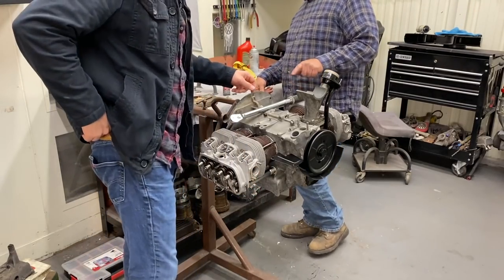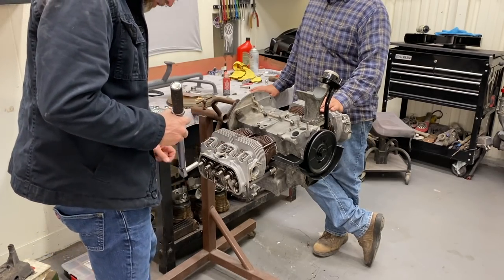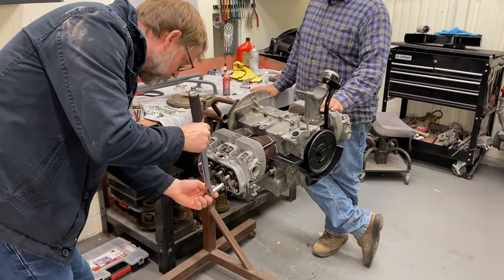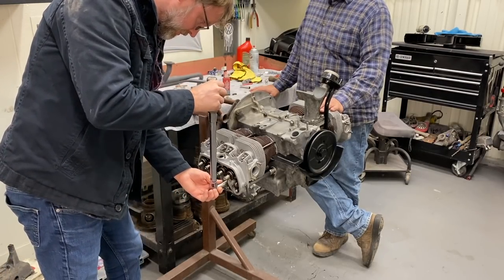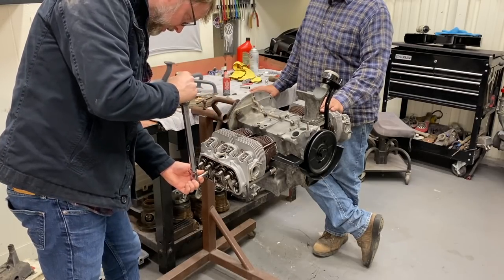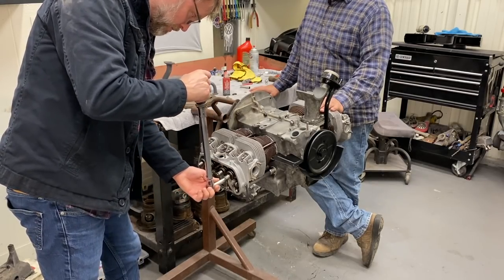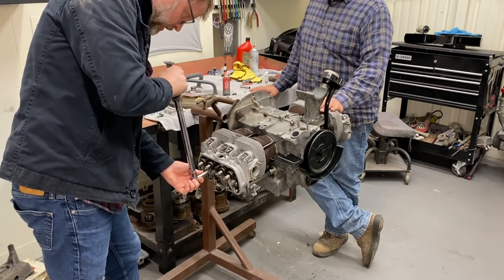That's impressive. Just go ahead and torque it up. Yeah, I've torqued the two rocker nuts. The rocker nuts, okay. And we're set to 18? Yes, sir. You're pretty much right on already. That was a little loose. Just go back and forth a couple times? Check it twice. 18 foot-pounds. That's pretty much the standard for these.